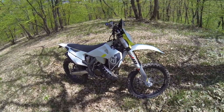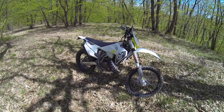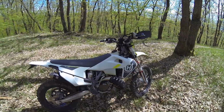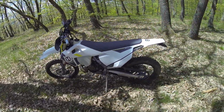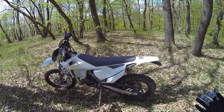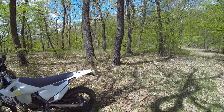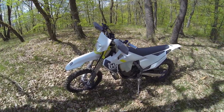What I really don't like a lot is the two-stroke sound and the feel and the smell. I love it being a TPI. I think they built this 150 to replace the 200 series they had in the past. It's actually more powerful than a 200. I used an old carb 200 bike, and it's very different. This TPI bike, you can just lug it, and to be honest, I can go anywhere a 300 goes. You just need to work a bit harder on switching gears and slipping clutches, but it's not the screamer that everybody's used to with the 125 bike, so it's a completely different bike than the 125.